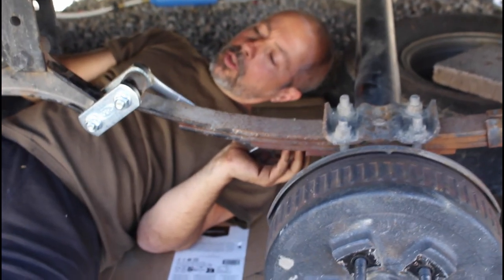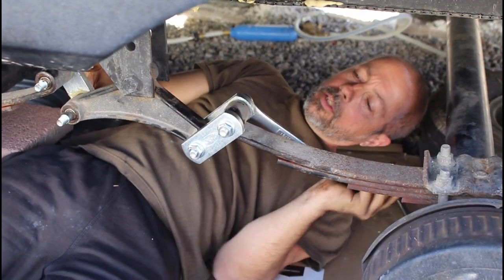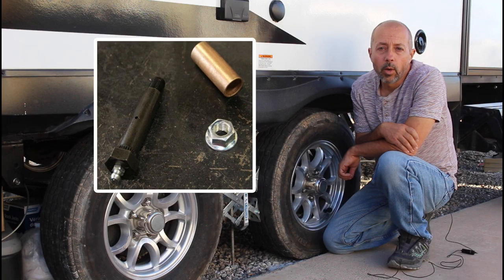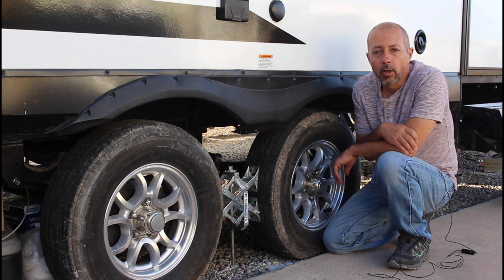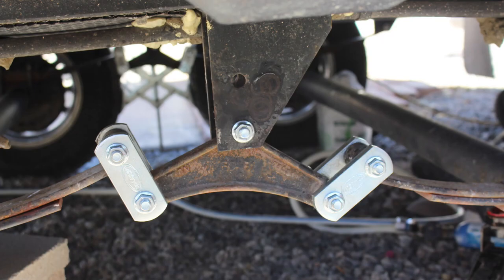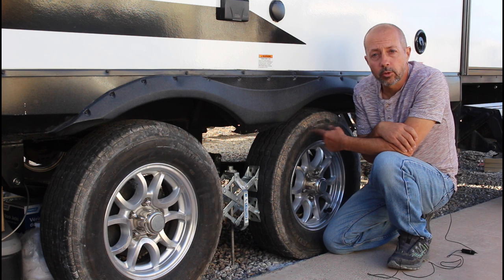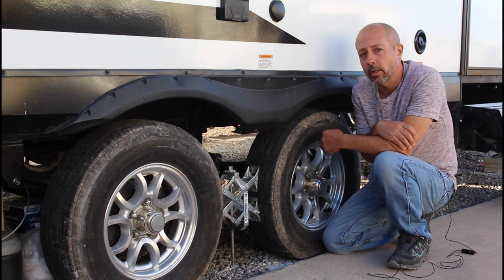Use a wrench to position the equalizer a little differently and get the two holes spaced for an easy insertion. When installing the wet bolt, try to put the lubricating hole to the side rather than on top or bottom — this makes it easier for the grease to flow in later. The wet bolt can be installed from the outside or from the inside. I installed mine from the inside, so I'll be crawling under the RV each time I need to add grease. On some RVs the tires may block access to the zerk fittings when bolts are inserted from the outside.